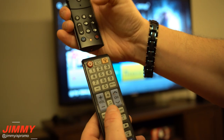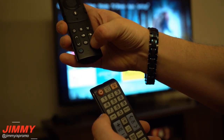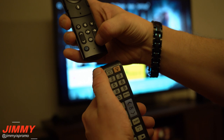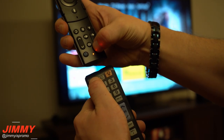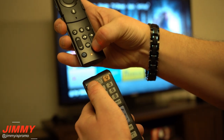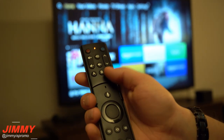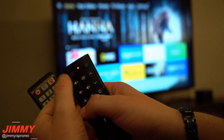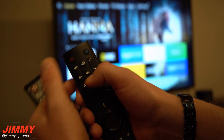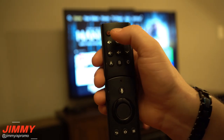Let's do the power button — hit the power button on the attachment, you'll see it blinking. Go to the power button on your TV remote, hold them one inch apart, press and hold both for three seconds, and that one is now set. Go through all the different programmable buttons on the very top this way, and when you're completely done, press and hold the red power icon and the mute button once, and you're finished.